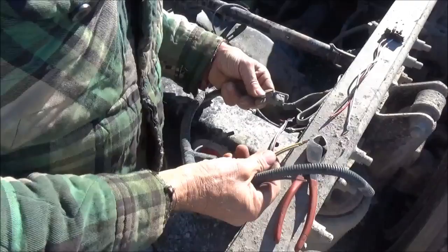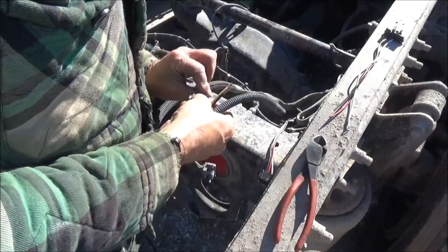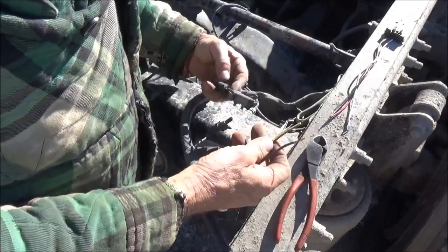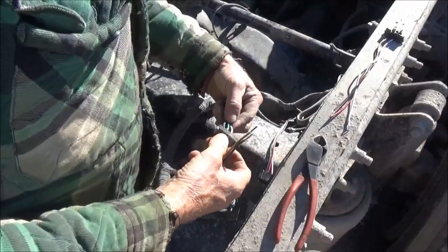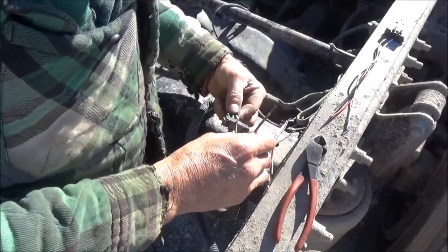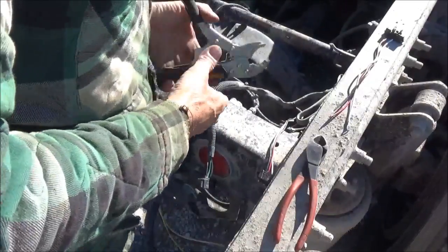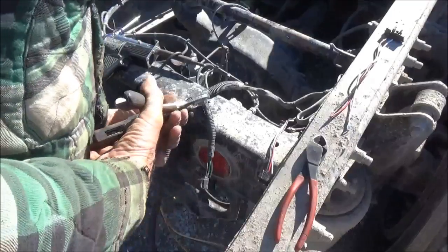The backup light is still in good shape. We probably have these two white ones as the ground. Since I don't work on trucks on a regular basis, I don't have all these colors memorized. But on cars, the yellow wire is going to be a left turn signal and the green one is going to be a right turn signal — not always, but in most cases. And these black ones, which would be brown on a car, are probably my tail lights. I've got the tail lights turned on right now, so I'm going to find a ground — clamp this vise grip onto something around here.